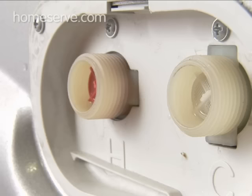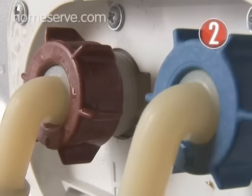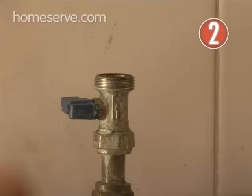Attaching the Water Supply. Washing machines are supplied with PVC hoses to link the water inlets at the back of the appliance to special miniature valves connected to the household plumbing. The hoses are colour coded — red for hot or blue for cold — although some new washing machines only need a cold fill. Make sure the valve is turned off, then connect the hose by screwing it onto the valve. Make sure everything is nice and tight before you turn the valves on.